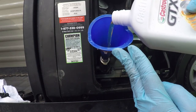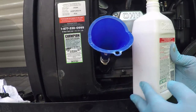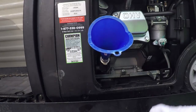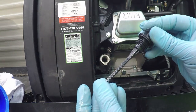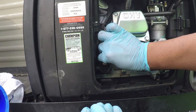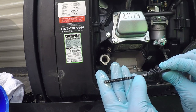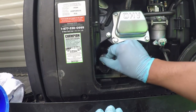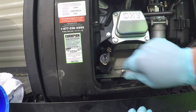That's one quarter of the bottle added. Now we'll check where we are on the dipstick. Looks like we're up to the full measure. The instructions say do not screw the dipstick in to get your level, so I'm just putting it in without screwing it in. Yep, we're right at the F of the full mark, so we're done there. Make sure the fill cap is nice and tight without overtightening — just don't overtighten with engines. Nice and firm, we're good.